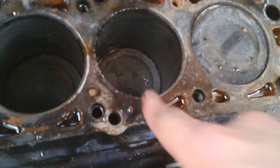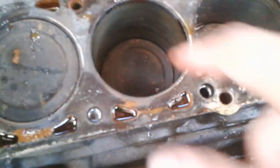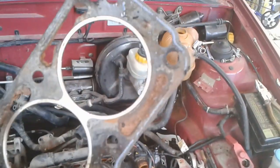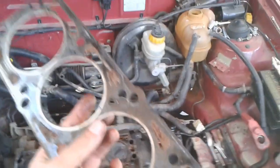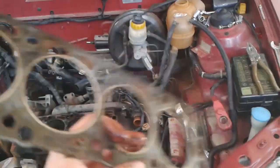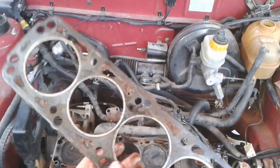Cylinder three looks like glass - it has a mirror finish, which is really bad. The other one looks better. I have no idea if those blocked passages are just how this head gasket was designed or if they're clogged with rust. The head gasket looks like it has some sort of small hole where you see all these huge marks. I'm not sure the engine was being cooled properly using this head gasket.